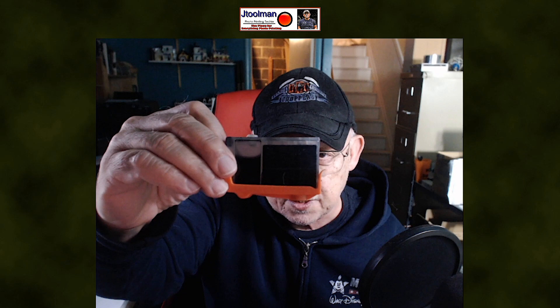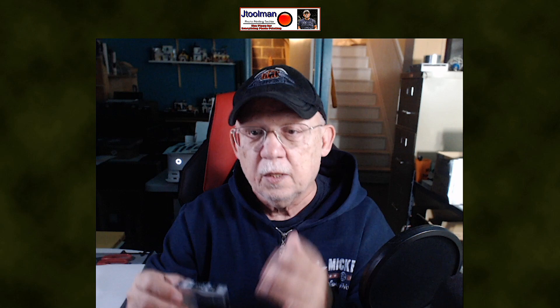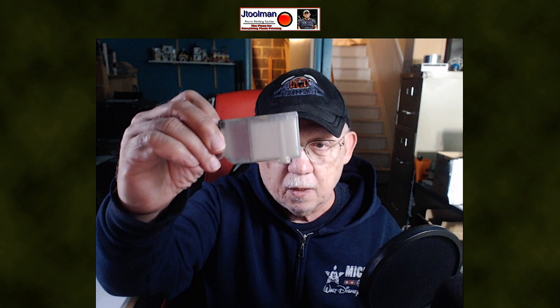Let me show you one that is full. You'll see that right above the sponge it is saturated to the top and it is clear. This upper section here is a serpentine vent — it is clear, not loaded with ink, which would prevent ink flow. Today what we do is flush the cartridge after we've drilled the top and tested the plug. We run Windex — you can add a little extra ammonia — it will clean that ink right out.